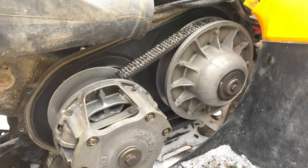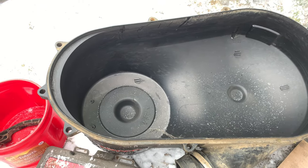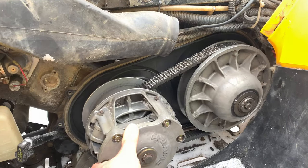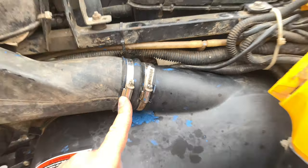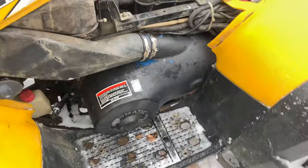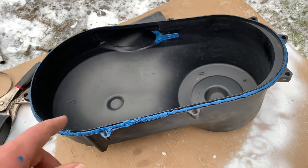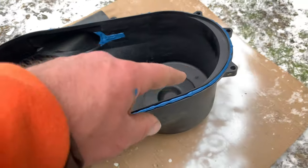I'm thinking the reason this belt went — from what I've read on blogs and other YouTube channels — is these covers right here. What people end up doing is cleaning that real good with a brake cleaner or something to get the dirt and grease off, and then putting a small thin layer of RTV. The moisture and water just destroys these belts. We scrubbed it with a hot soapy brush, wiped it off, and let it dry in the house for 15-20 minutes. There was a crack in this, so you want to get the moisture out — that's what ruins these belts. Get that RTV around there.